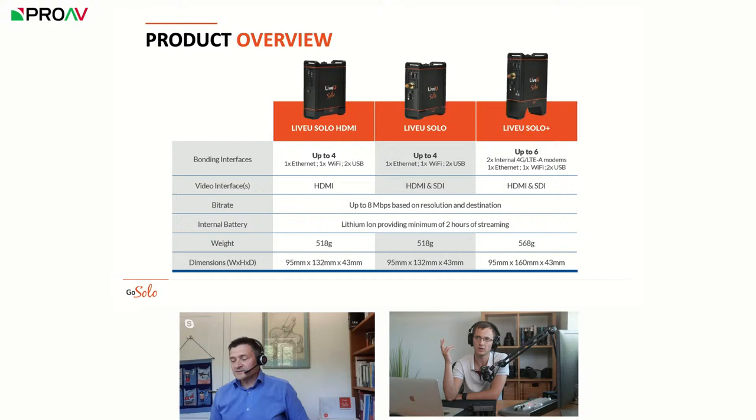Yeah, and I assume the recommendation is to go for different networks each time. So don't go for three Vodafone ones. Yeah, there are some elements to that depending on where you are. But at the end of the day, if Vodafone and EE have their own separate cell towers, their own backhaul infrastructure, if you're able to use two completely diverse physical networks for streaming, it's better to do that than to put two Vodafone SIMs in and double up on their network. You have more diversity going with different cellular providers. Gotcha. So if anyone else has any more technical questions about the product, let us know.